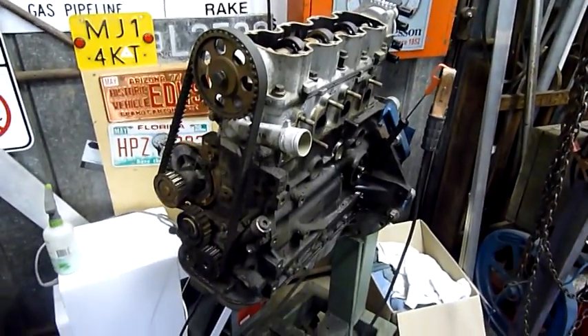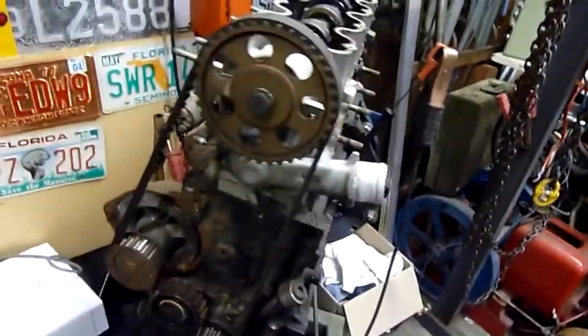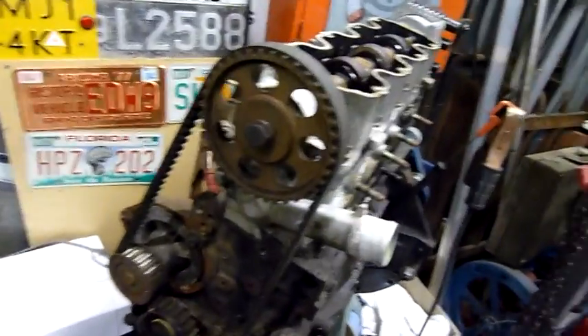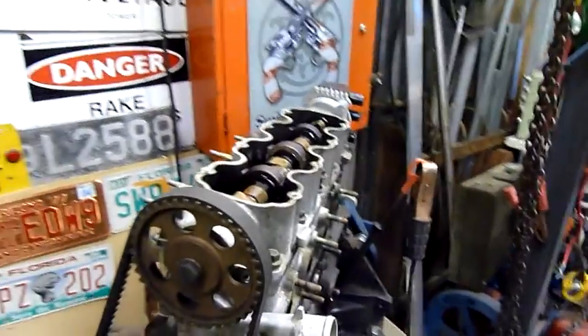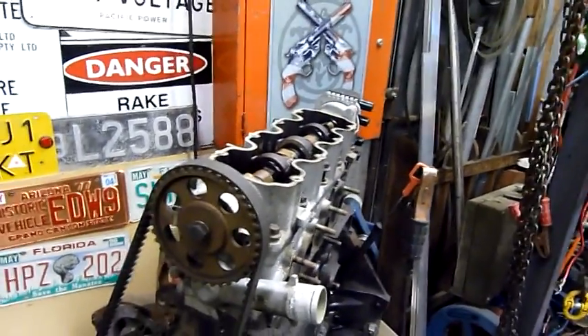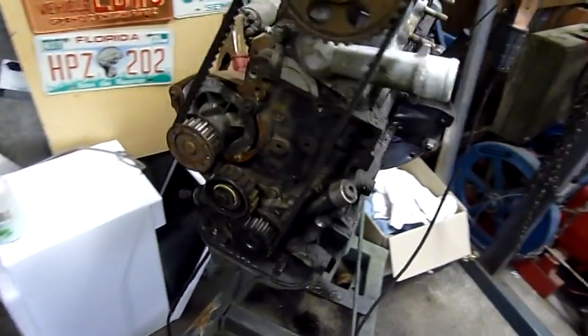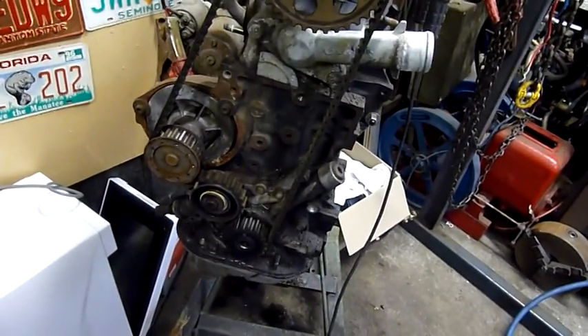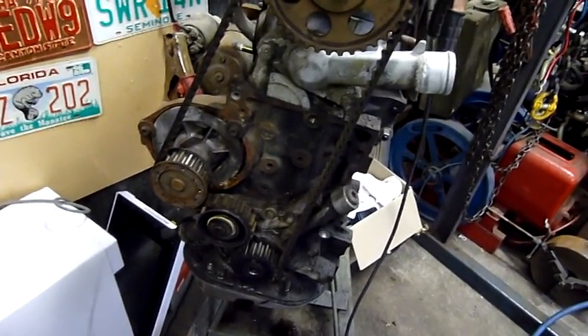G'day folks. Before we strip the rest of the timing gear off, I put the belt back on - it doesn't appear to have moved when I removed it, it doesn't appear to have run backwards and skipped teeth either. So all the unhappy noises and running issues with this engine were probably either sticking valves, or it's just trashed - detonating it on Jet A1 and a bit of gasoline mix was quite brutal on it.